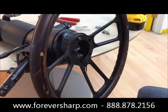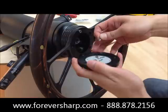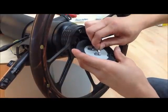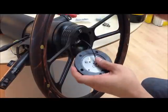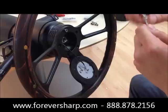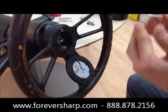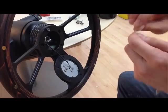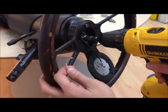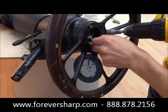Now you want to grab your horn, get the lead wire with the spaded connector, and you want to install that into the center post. Now you want to grab the other extra wire included that has the spaded connector, you want to snip the connector off so it looks like a bare wire. With this, you want to loosen one of the hex bolts — this is for the ground — just a little bit, and then slide the ground wire in and tighten it down.